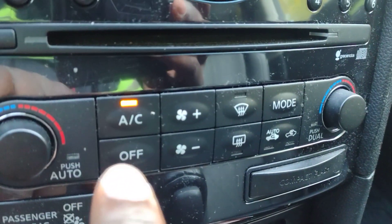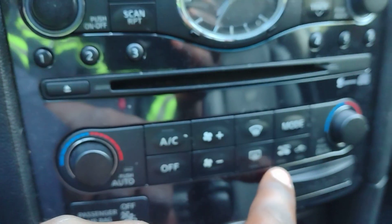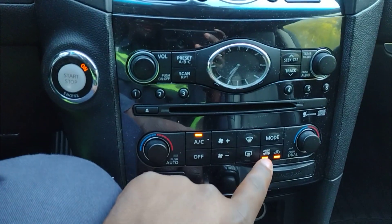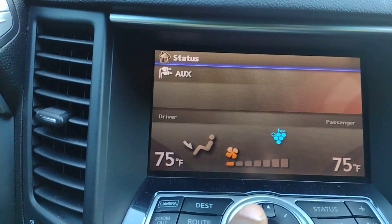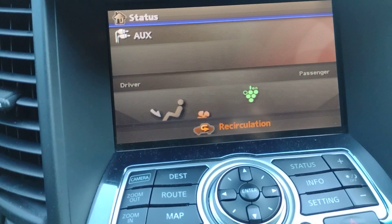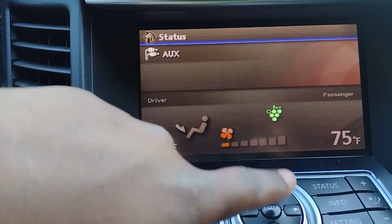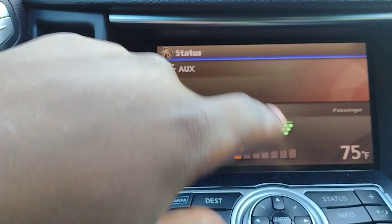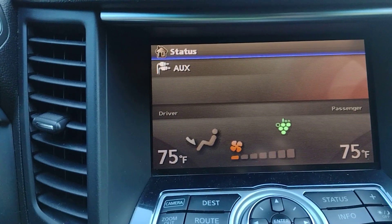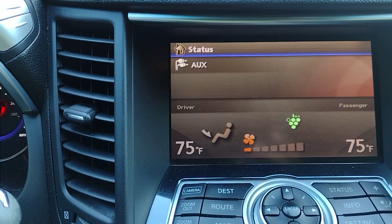So it's in fresh air mode right now — let me demonstrate. I'll turn off the AC system and then turn it back on using just the fan. Okay, it starts on auto anyway. But if you force it to either manual recirculate or manual fresh air, it starts green, and then what happens is it changes every 15 minutes instead of 30 — so it becomes 15 minutes blue, 15 minutes green, equally. If you've got a long commute, take the opportunity to observe how long it takes between changes.